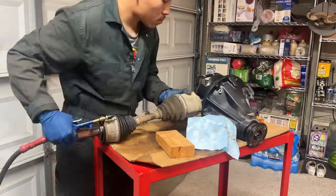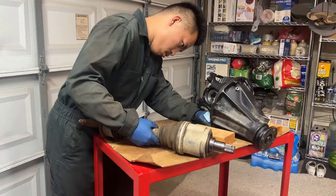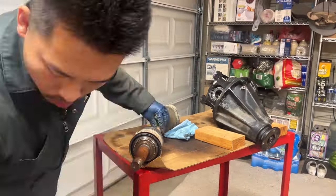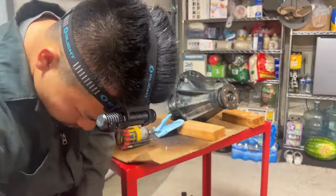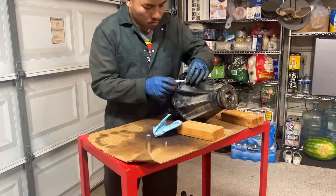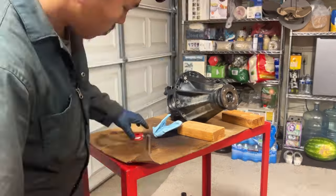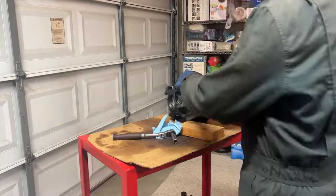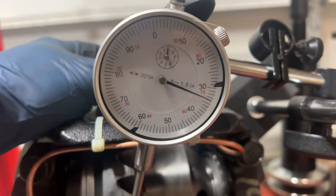After getting everything buttoned up with the fittings, I was testing it with air and trying to put an axle in to see if it would engage, but the axle didn't work — you probably need a custom tool. The air locker itself isn't faulty; as long as you install everything correctly it should work and you'll hear a little click. I used Teflon tape on the fitting. Note: the ferrule, the little gold cone thing, does crush the airline so don't install it until you insert it into the airline.